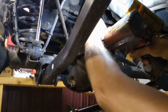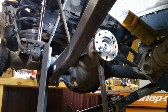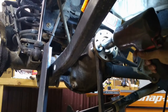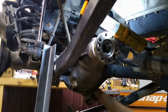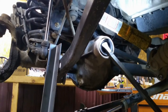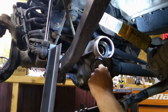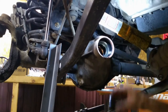Now it's time to pull our pinion. Sometimes you can grab it with your hand and pull it off, but most of the time you cannot. I stuffed a bolt in the one opening that was there and got my pinion nut off. The pinion is not just going to come off — you'll have to use a puller or you can use an air hammer. If I know it's a pinion I'm not using, I don't mind banging on the end of it with my air hammer. There are some things underneath you need to pay attention to — our oil slinger and our bearing, both will be replaced. The crush sleeve stayed in there, and there is also a bearing cup that needs to be removed.